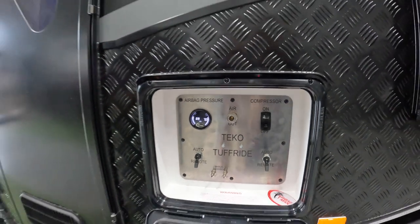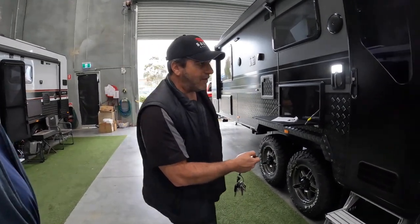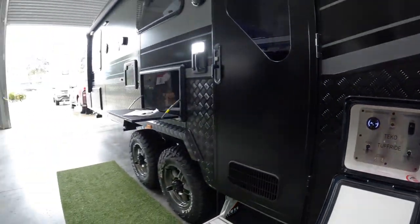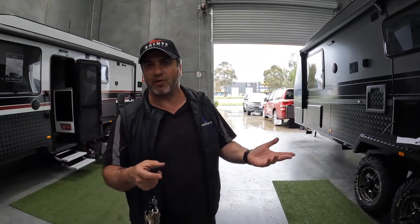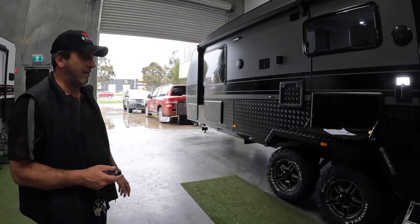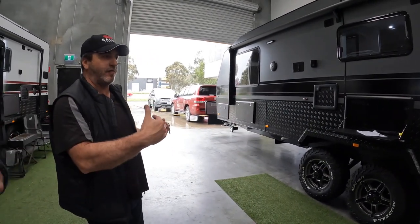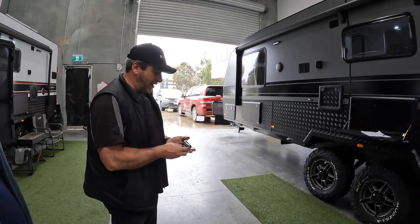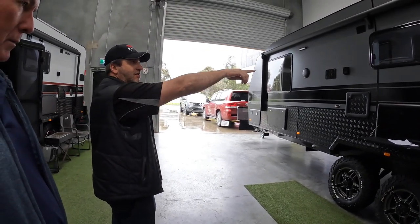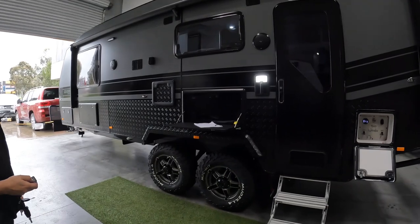Go a little bit more. Done that and you want to start, you want to get it to do self-leveling. Because right now, if we were on uneven ground, let's say it was higher on that side, on the upper side, so that upper side there would be up like that, then I would deflate that side to even it up. All right? Yep.